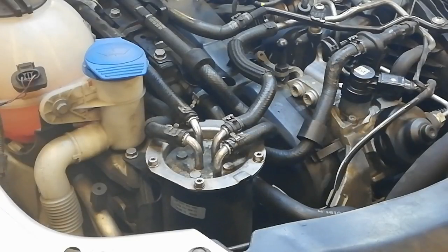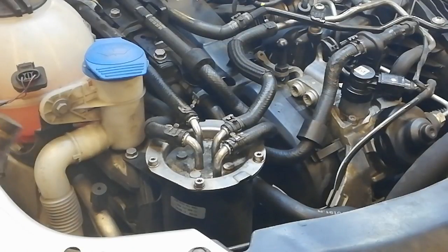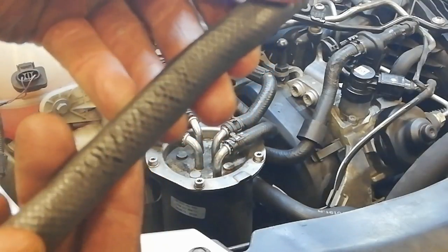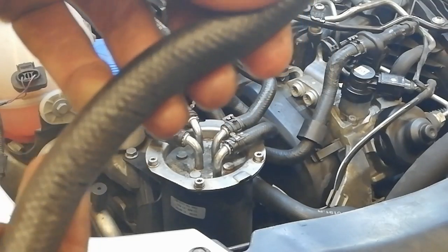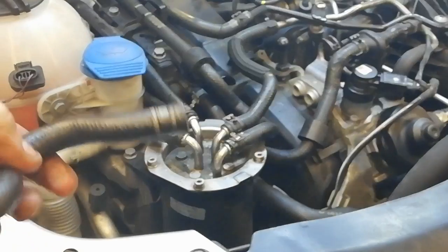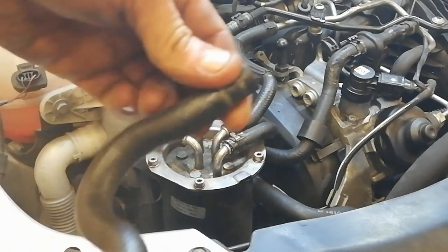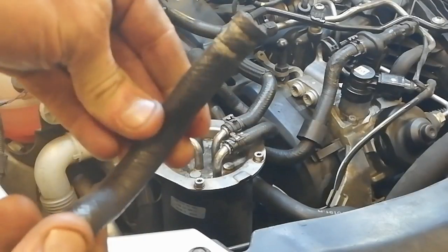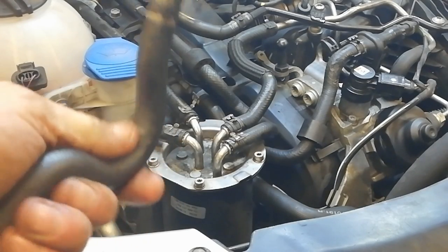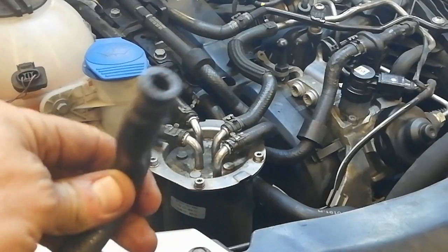One last thing: if you see diesel pooling around this area and it's all wet, it's worth checking this pipe. This is off a similar car — what happens is it starts to crack on the inside of the bend. With capillary attraction, the diesel runs down the bottom of it and ends up pooling on top of the canister. The pipe is bent that way to allow for engine movement. It takes quite a while to develop, but on higher-mileage cars with some age on them, you can see those pipes cracking. Anyway, hope you got something out of that video — thanks for watching.